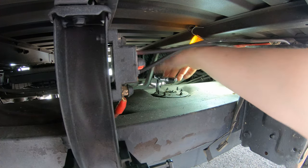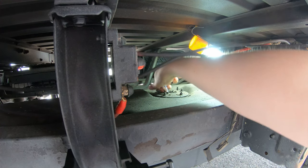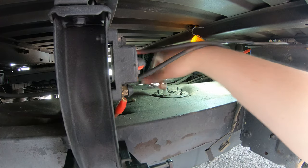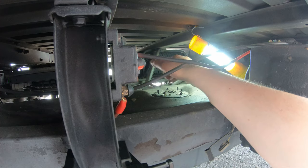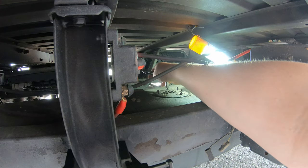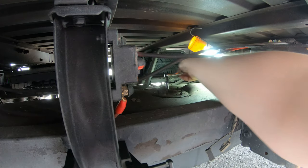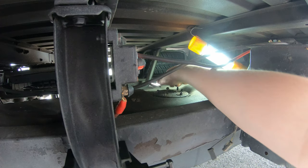I'm going to take my tiny little ratchet here and take this out. The recommendation is, of course, to take off the negative terminal of your battery before doing this, or the positive terminal — standard affair. Always disconnect battery before service. Anyway, this one, since you're working with explosive vapors, may not be too bad of an idea.